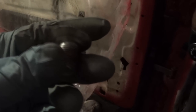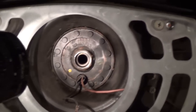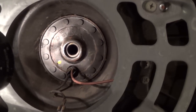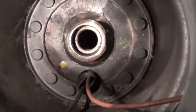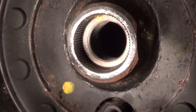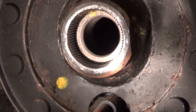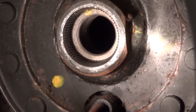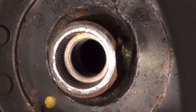This is a bolt with — I'm not sure how exactly to describe this kind of edge here — and the 79 steering wheel is still on. Now the splines are the same and the steering wheel did go on, but I want to show you how it is different inside here, let me just zoom in. You can see that the splines there are not dished to accept that kind of bolt. The bolt does thread in, because it is the bolt for the 83 and was attached to this steering column, but I don't believe it would adequately hold down the steering wheel.